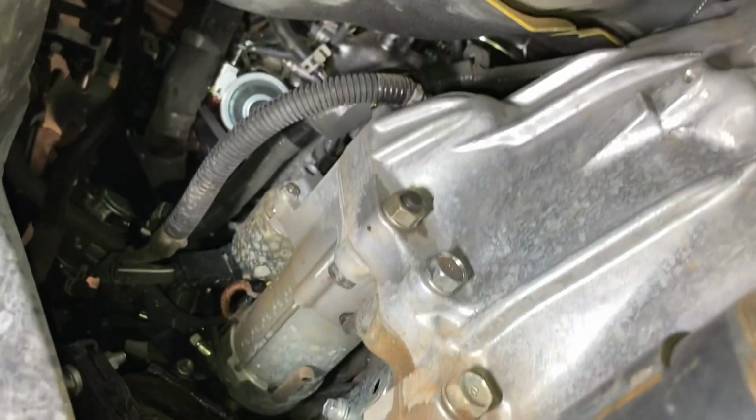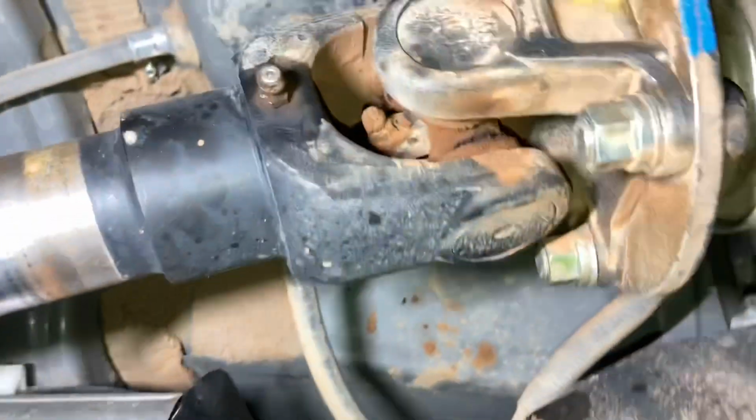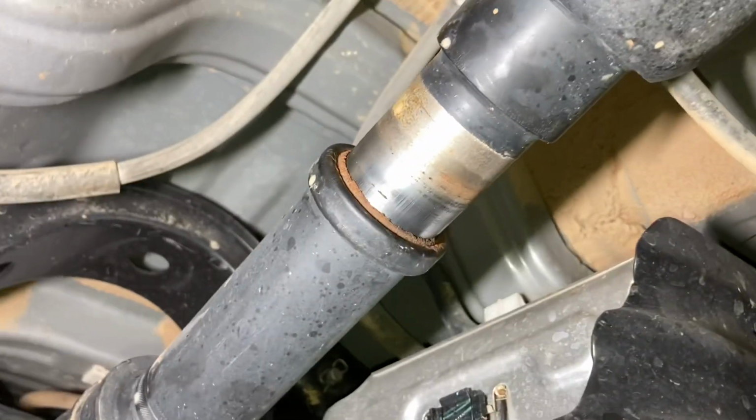We're going to, of course, lube the drive shafts. I note that on our services on the 2019, the dealer wasn't lubricating the drive shafts, or certainly there was no evidence of that. But then you could almost say that here. We've got a bit of grease coming out, but this looks pretty dry as well. It certainly needs some lubrication. We're not over-lubing it, but it's about to get some more. So maybe they were lubricating it, but they weren't overdoing it, because we certainly haven't made a lot of mess here.